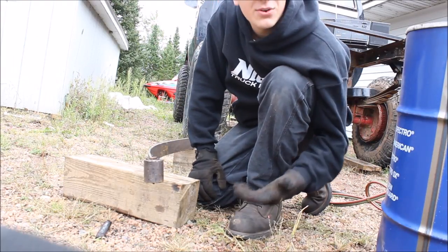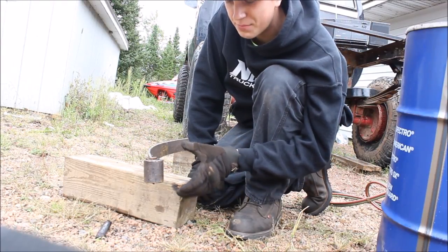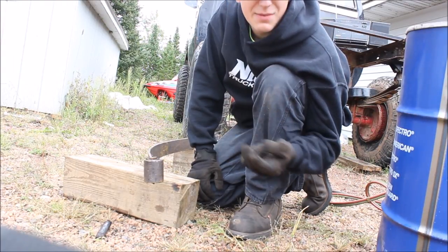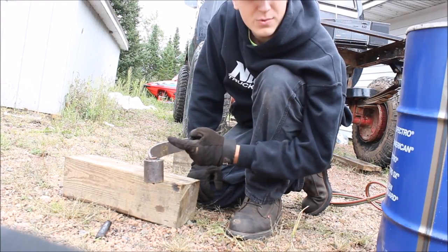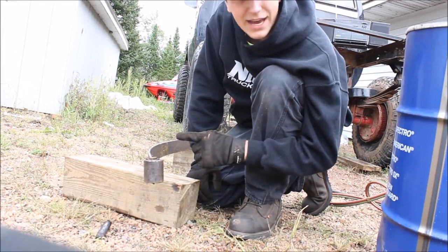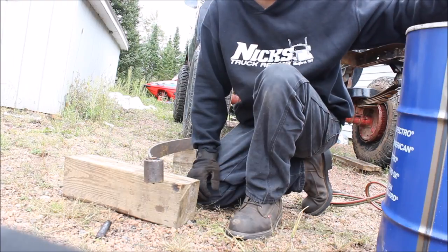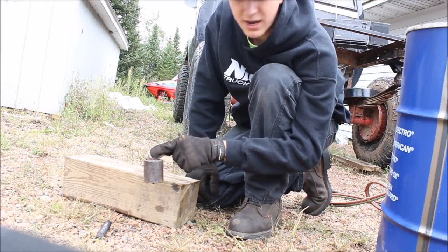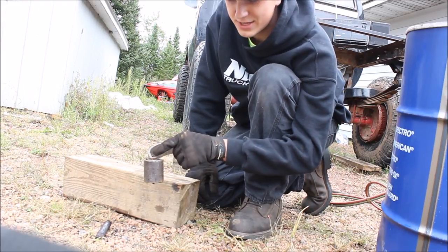The problem is how do you get it out? Some people have presses, some people use a ball joint press — you can do that. But if you have two things a lot of people already have, you can get these out in like a minute. What I do first is take an oxygen and acetylene torch — not a little handheld one — and I fire it up and heat this middle pin up until it's pretty hot, pretty much burning that rubber on the inside. I'm going to do that right now.